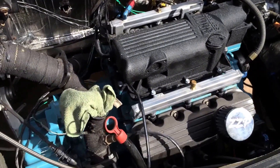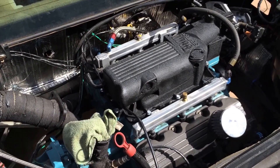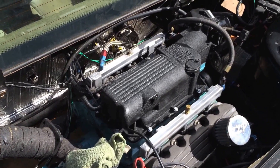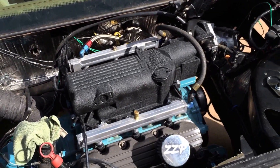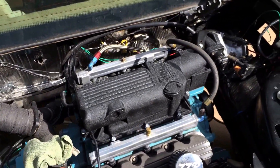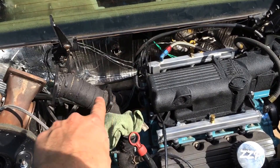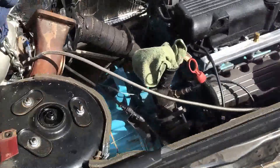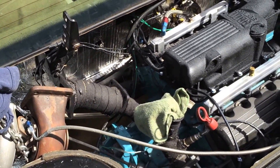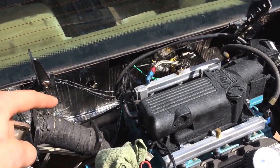The engine itself is still the supercharged block, but in the quest for power I decided to take off the supercharger and fit a normal intake so I could run the turbo. I chose this intake — I think it's from a '97 Camaro — because it moves the throttle body over to the passenger side instead of the driver's side, where it would be very conflicting with the turbo and just a really cramped, dumb setup.